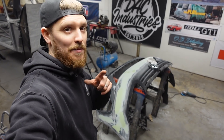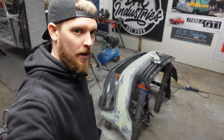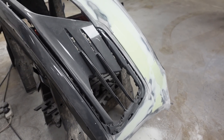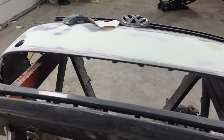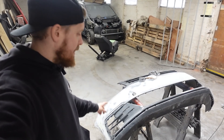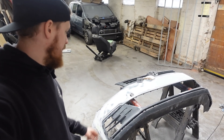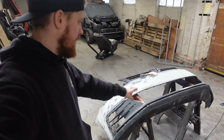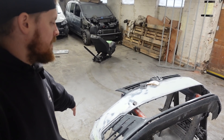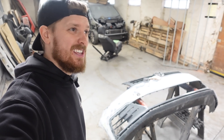Apparently the camera decided you'd seen enough sanding and didn't record me sanding this bumper — the red light was on but it didn't record. Anyway, it's not like you don't know what sanding is. That's the first layer done. There were a few little bits that were low so I've put a bit more on. Looks good, feels really nice. We now need to sand these extra bits back, then key the rest of the lower paint on the bumper, sand a bit more of the texture down on the top, mask the grill out, and get it in the booth for some high build primer.